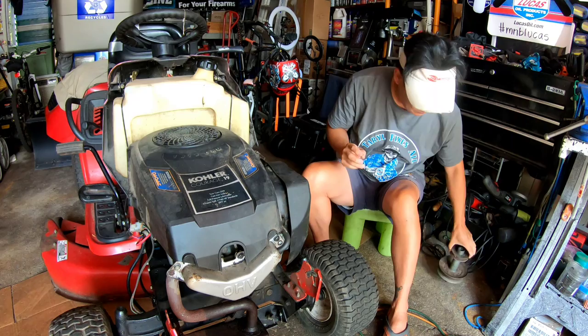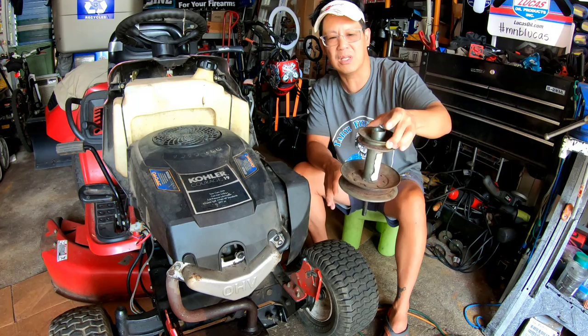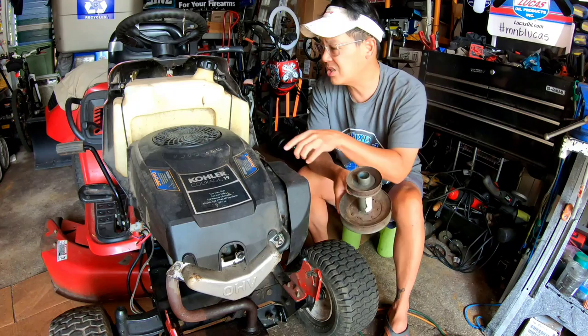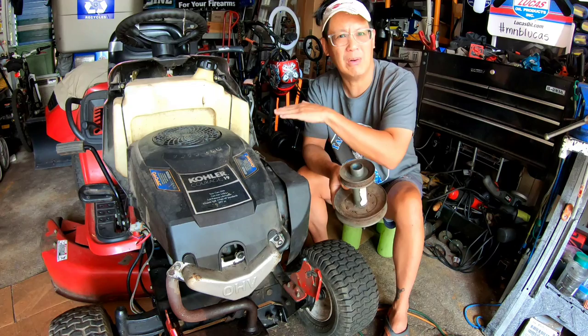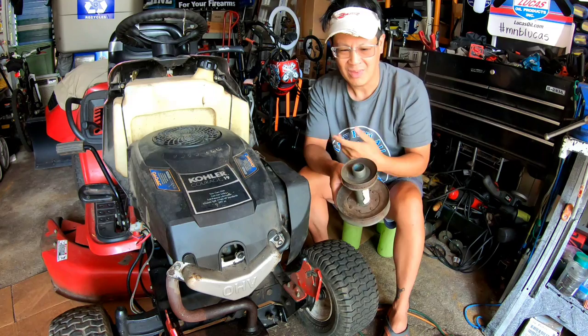I got my double stack pulley here, see? It's kind of like the MTD kind. I have about 5 or 6 pulleys. What I'm a little concerned about is this. The stock drive belt on this is a 5/8 by 90.5 belt. That takes it to the transmission pulley. On the transmission pulley, apparently it's a double stack. So the other part of the pulley is a shorter belt, like 40 inches, that goes around the variable drive, okay?